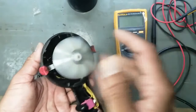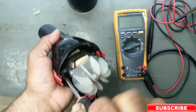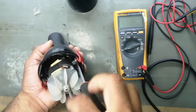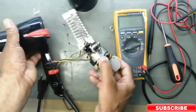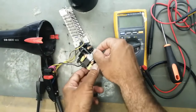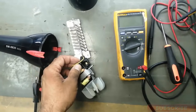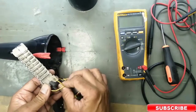It has a dryer fan, a blower fan, and two screws for locking the motor and the heater. There is one dryer fan and one blower fan, and in the front there is a heater. This heater wire has two elements. One is for low heat and the second one in combination makes full heat. It has three connections.